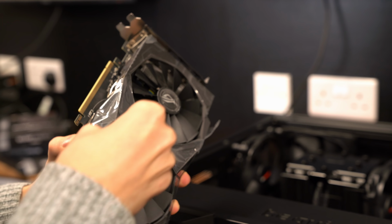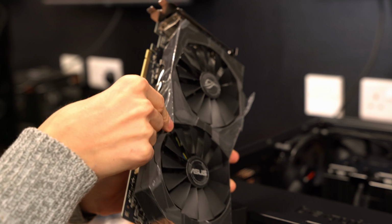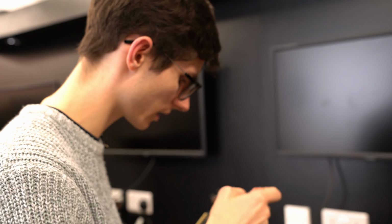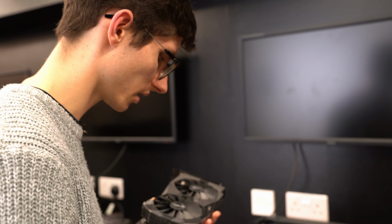We're actually almost there now. It's just time to get this, oh that was shocking, wasn't it? It's just time to get this graphics card installed, and then I think that is pretty much everything done that I need to. Because we're using an M.2 SSD, there's very little that needed to be managed inside. It's just a case of slotting this in, making that very satisfying noise. We can get that lined up. Boom. This is the final piece of the puzzle. It's now just a case of making sure it works and then doing the finishing touches and tidying it up.